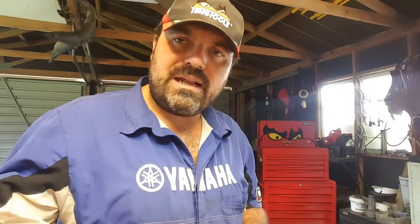It wasn't the easiest thing to see what I was doing on the car as we went on to adjusting the fan belt, so I'm going to do a quick diagram to show you exactly what's going on and how that belt tensions up on that particular car. Those Ford Lasers are pretty much the same as your Nissan Patrols, your Ford Couriers — most alternators mount just with two mount bolts. They have a main pivot down the bottom and then they have the slider mount, which is pretty much opposite. You undo the slider pinch bolt, and then you can lever the alternator back a bit more and it holds that position.